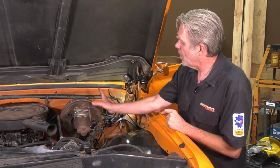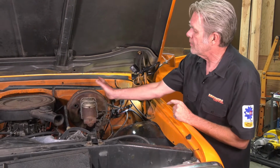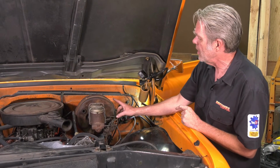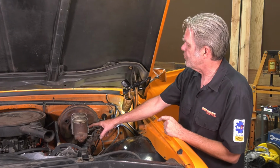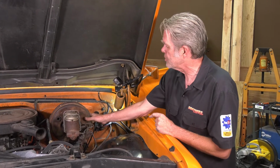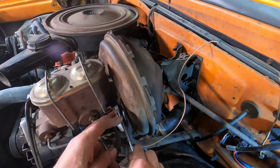If you get all of these off and then one bolt is hanging you up, you're going to have trouble with everything flopping around. So loosen everybody up and then take the bolts off. You'll be taking your bottom bolts off first so it won't hang down on you, and taking your support bolts off first, so it goes a little bit something like this.